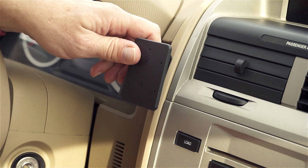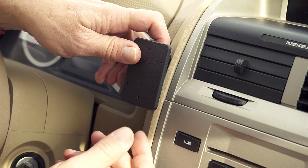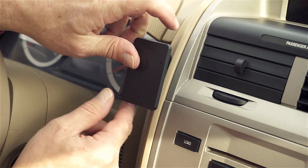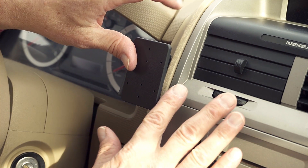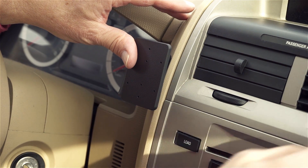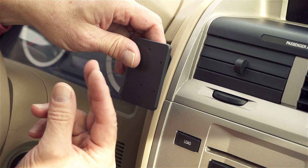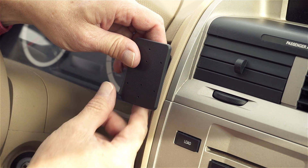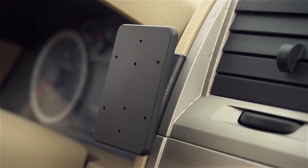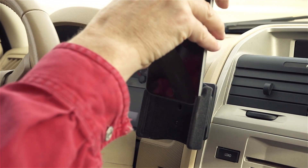Just like that — you can remove the gap opener. The ProClip has a little bit of flex to it, and you'll need to flex the ProClip towards you. Take the right L-shaped angled edge and slide it into a seam. There is the frame around the center console and then there's a frame around the vent area. Flex it towards you and it'll slide and hook over. The angled edge should go into the seam between those two panels. You'll hear it click into place. Once it's attached, you'll have a nice solid mounting platform to attach a ProClip device holder onto.